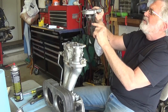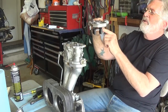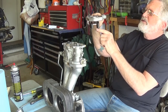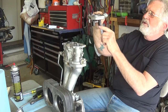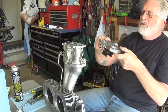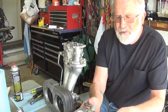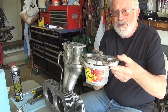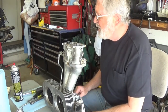And it's not where there's the needle, you can't see it. The needle has a pin coming out of it, and it's not when that part goes up and down. And once it comes, now I've made contact right here, and it'll go a little bit further. To be really truthful with you, I've had them less than perfect, and they worked fine. Now, I'm going to set it on this container so it's supported, but the weight of this isn't on the float. You're bouncing around in the car, I know.